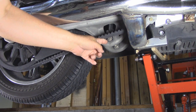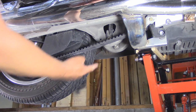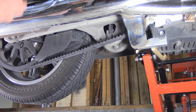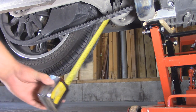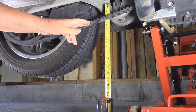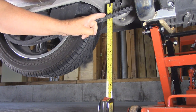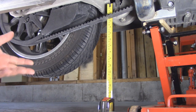For me, there's a bolt holding my shock absorber on that lines up well with that midpoint. Some people who know their bikes can simply push up on the belt with their finger and say good enough. I keep detailed records and like to know the numbers, so I'm going to use the gauge and a ruler. Some people use a measuring tape on the floor behind the belt, but the problem is it's not perpendicular — the belt is at an angle, so you'd have to move the tape at an angle and subtract from the higher number. It's not difficult, but it's an extra step.